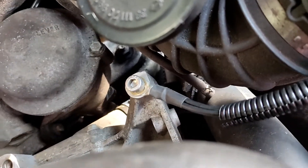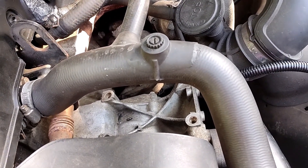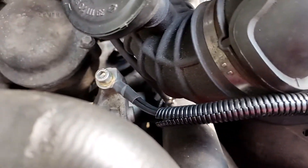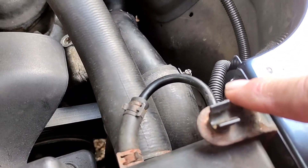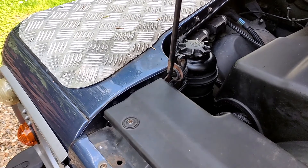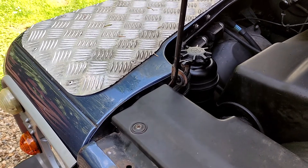This is my revised earth — an M8 bolt going straight into one of the mounting bolts for the cradle for an aircon pump on models where that's fitted. I've got an earth now coming straight off the engine block in effect, with two cables: one up to the headlight here, the other going into the loom which crosses the top of the radiator shroud and over to the other side, effectively taking both the headlight and dipped main beam straight to the engine block for an earth. I think that's better than the option suggested by the Boomslang loom itself.